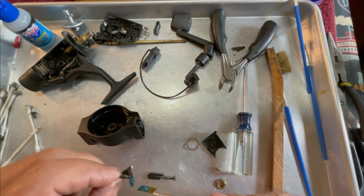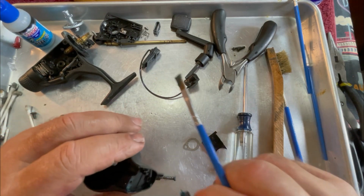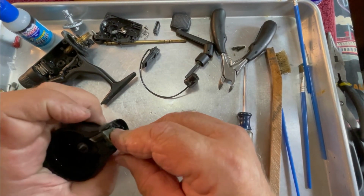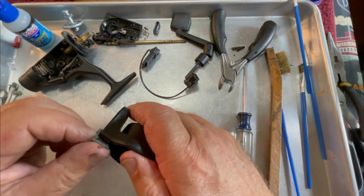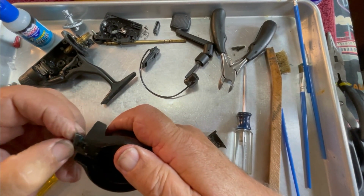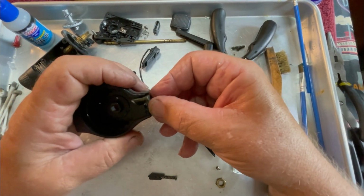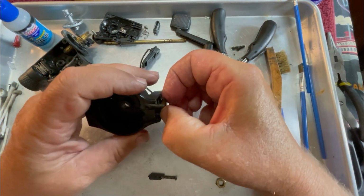This piece here is sticking inside the case of the rotor. So I'm hoping, now that I've cleaned it once again, it's fitting really tight in there. And now it appears I have too much grease in there because it's creating a compression and popping it back out. Grease will not compress. It's just like water or any other liquid. It will not compress. So it's creating a hydraulic problem there. And I'm going to have to get some of that grease out of there.